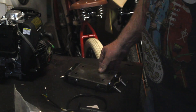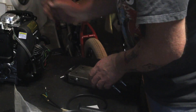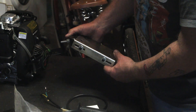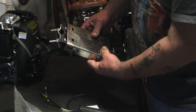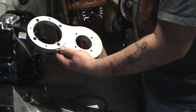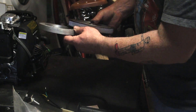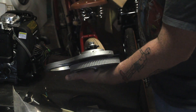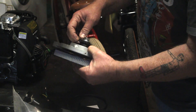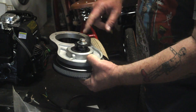Inside your kit you will have your motor mounting plate. You have four mounting holes on the bottom of the motor that will mount to the silver plate. You have the two cast black pieces which mount to the frame — remove the nuts and put the plates over the frame members. We will have to do some grinding on the motor mount to get it to fit properly. You also have your transmission mounting bracket — the larger opening mounts to the motor, the smaller mount is where your reduction gear will go. You then have your sprocket for the drive chain. We're going to take a file and dress up the teeth on the sprocket — these teeth are very square and sharp, they were not deburred well enough at the factory for the chain to run properly.